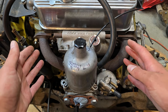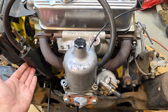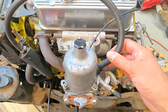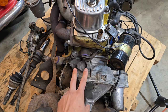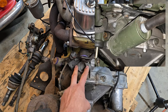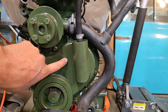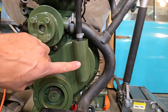So what did the factory do to control it? They added breathers. In this shot here you can see one attached to the tappet cover — a tappet cover breather, very common. It has a molded hose that goes straight to a fitting on the carburetor. This is a later style connection; earlier cars actually went to the air filter housing. There's also a breather that can go on the transfer case on later or larger engine cars, and some engines have it attached to the timing cover. So there are many places a breather can exist, but they all end up in the same place.